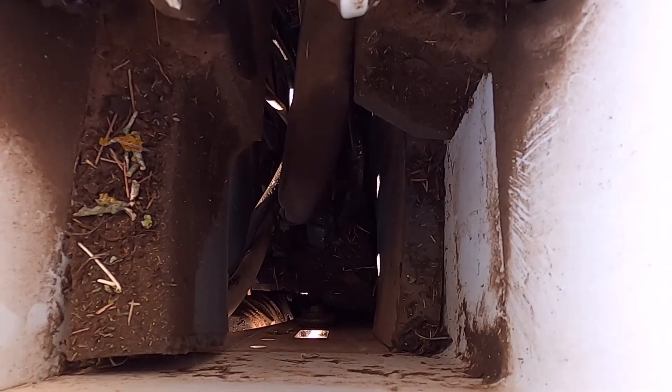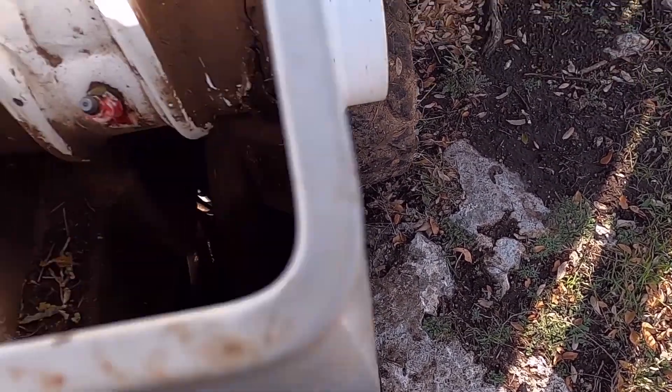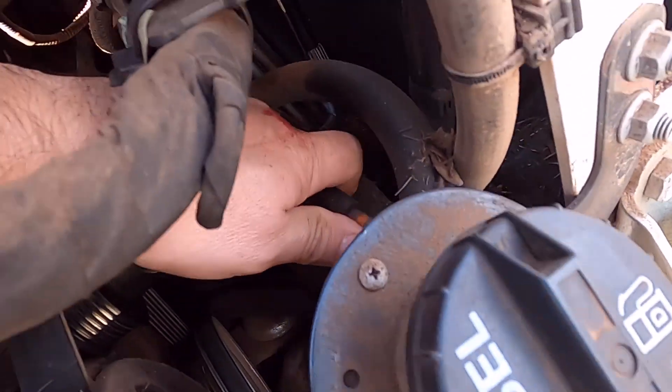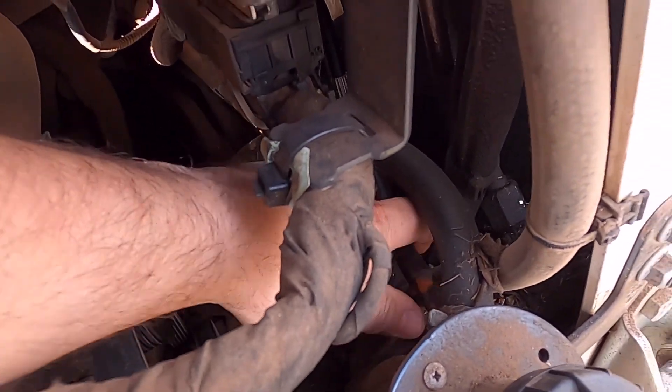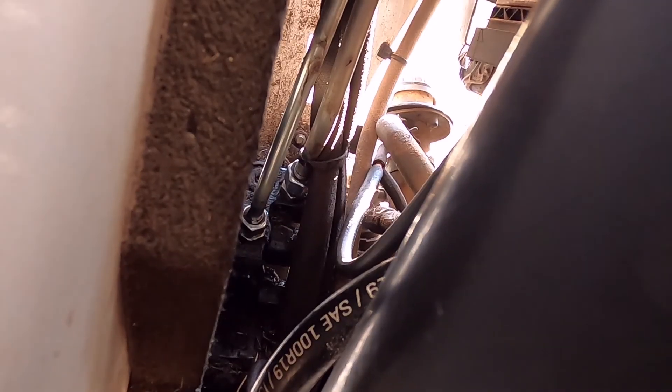Those don't look wet — seems like it's down lower. This hose here looks wet. There's no pressure on this one, it's like it just got sprayed or something. I think I'll crank it up and see if I can see any fresh fluid coming out. Looks like I got three things to be checking: two hoses and that one plug thing, but that plug thing doesn't look like it's leaking.